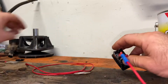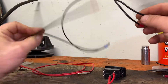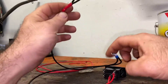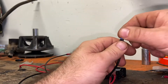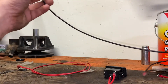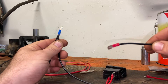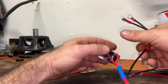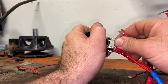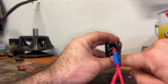Then you're going to make this other contraption - two into one. These are going to be female spades, then you come down to a male spade. Your main line goes two-to-one into a male, with another one coming out with a male spade on that side. These go on the two top terminals: terminal eight and terminal seven. These are your grounds.